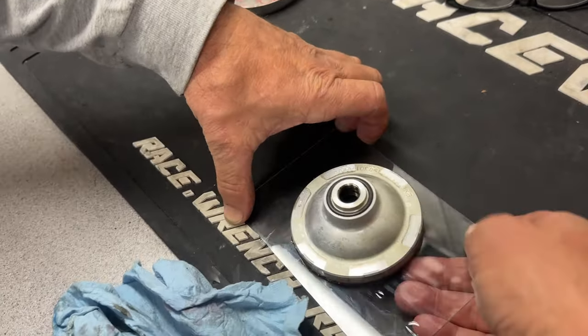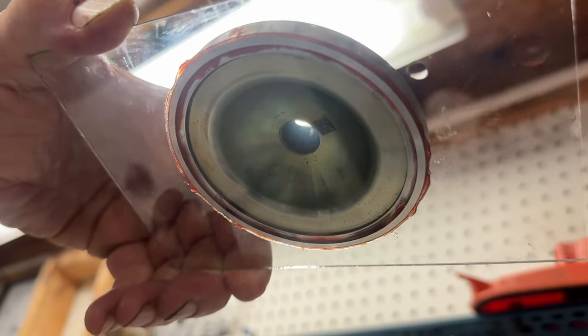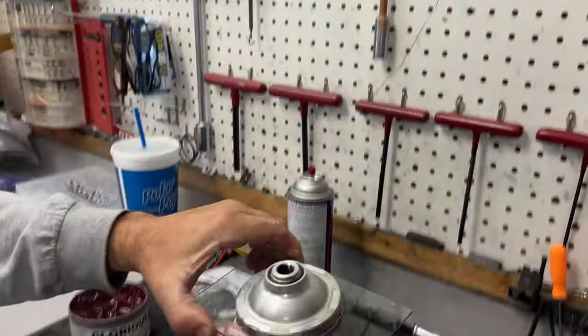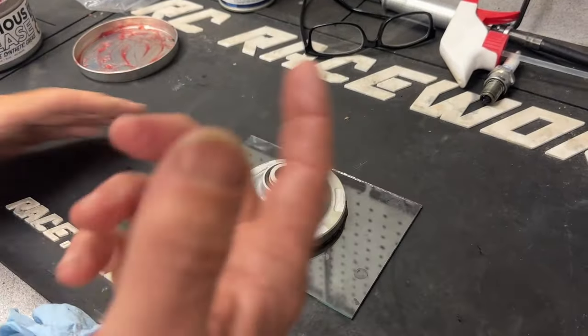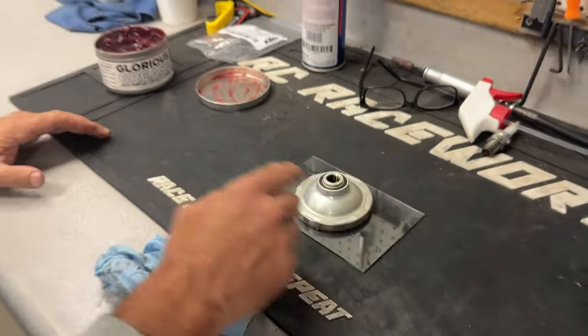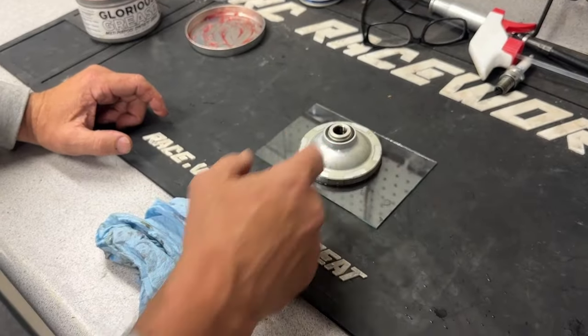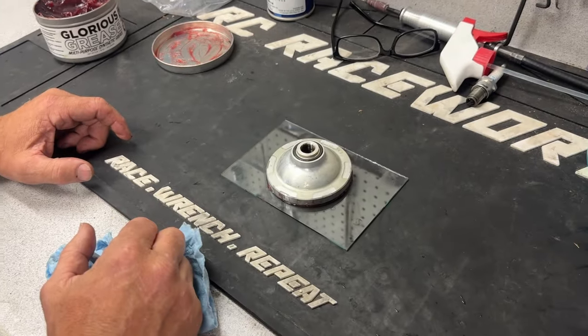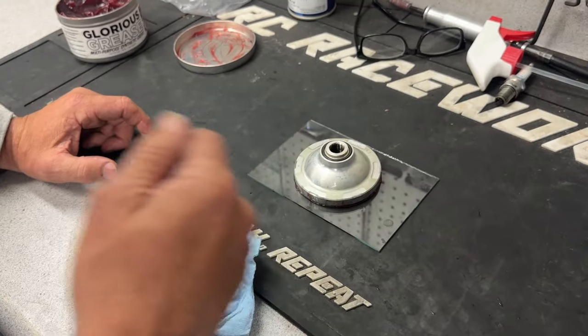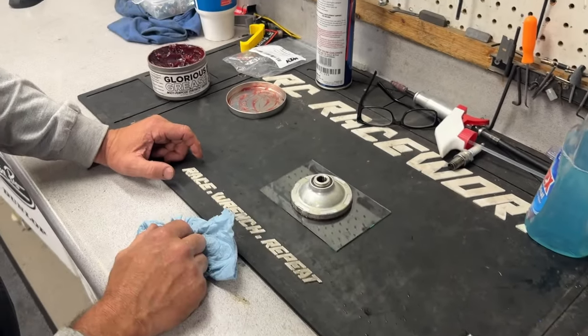So let's look at it from under here. You can see, and right at the bottom thread there. It's pretty good. Yeah, so I'd say 5 cc's of volume. Now, what does that mean? We got no idea. Other than this one has less compression. And so with an engine builder, and maybe setting it up, that's why the SX one has more hit, that bike then has more power, that feel, that response right away, and better power. So we're going to see how that goes.